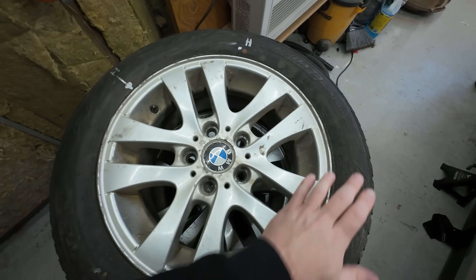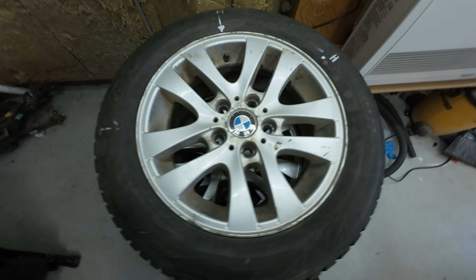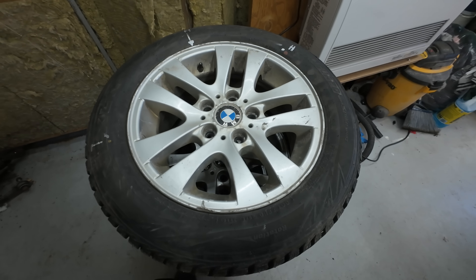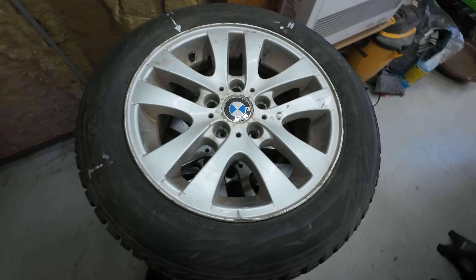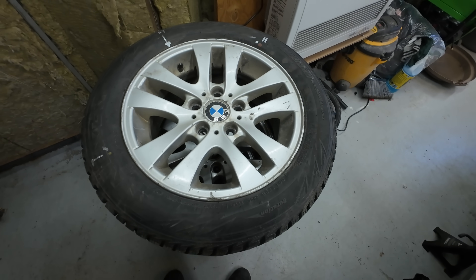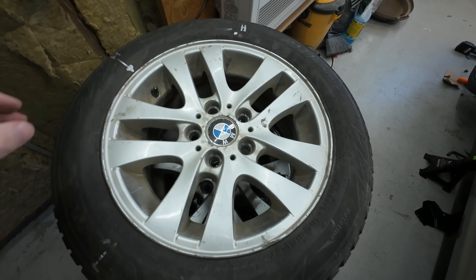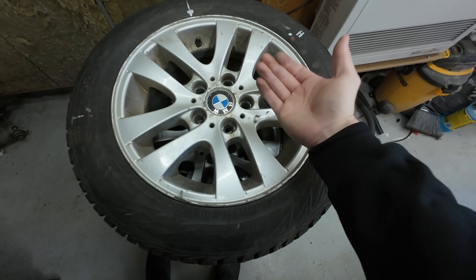One side effect of lining everything up correctly is you don't get comebacks for odd vibrations or shakes. Some extreme cases I've seen involve perfectly balanced tires but with weird wear patterns. After eliminating suspension and alignment, it comes down to wheel balance. You do a road test — no shake at 80, 90, or 100 km/h, but at 110 there it is. You throw it on the machine and it shows balanced. That tells you to crack the tire off the rim, rotate it, reseat it, and balance it again. Most of this can be eliminated just by using the dots correctly from the start.